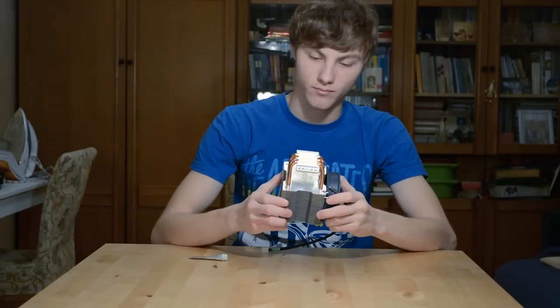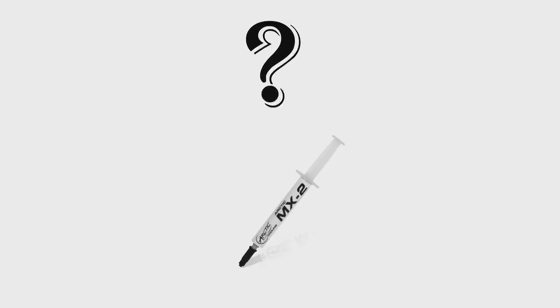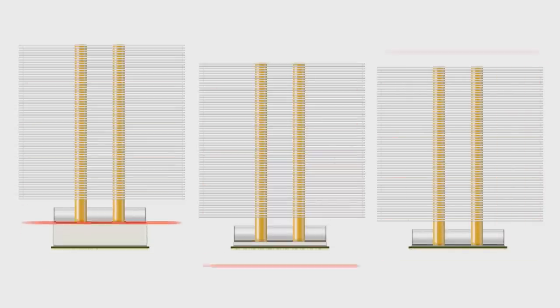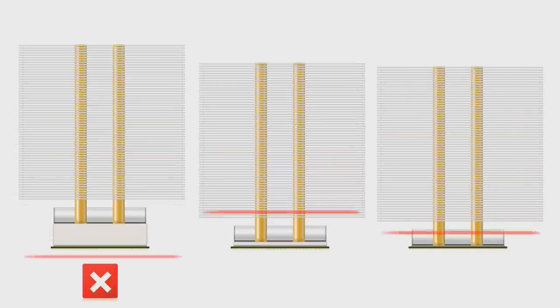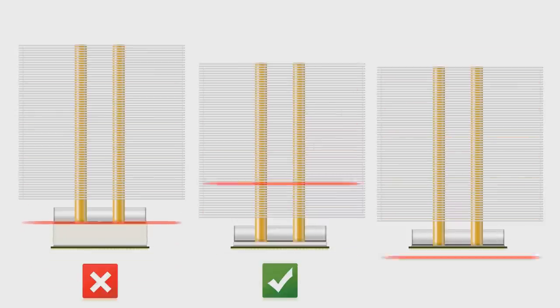But in our case, we have the contrary task. How much thermal grease must be applied for good heat transfer? The answer is: the less thermal grease you apply, the better. Thermal grease, like air, doesn't transfer heat perfectly — not as well as metal, for example. So the thinner the layer you apply, the better it transfers heat from the processor to the cooler.